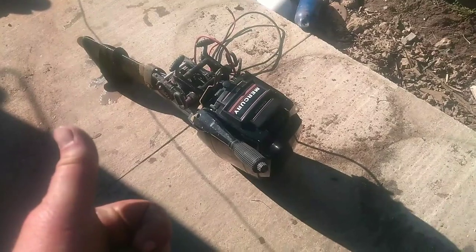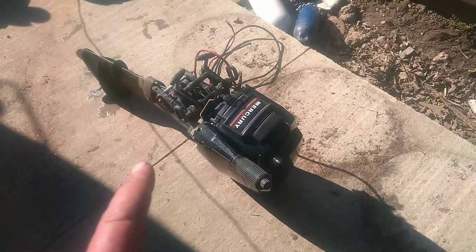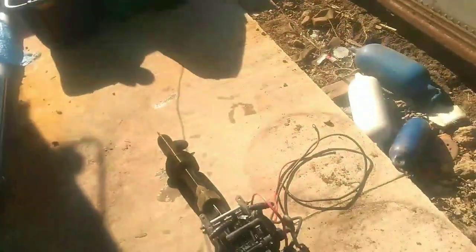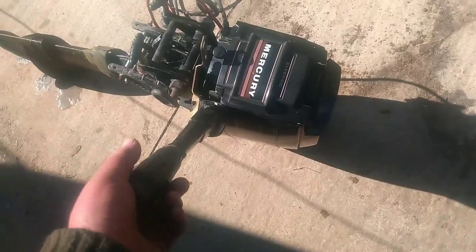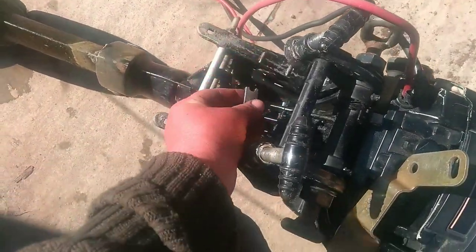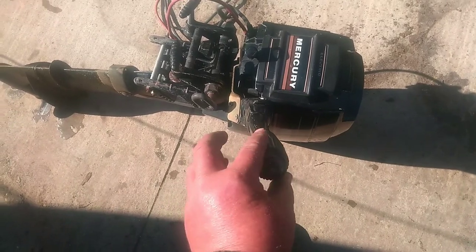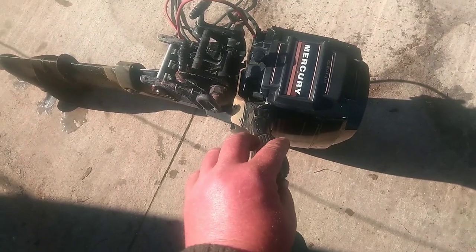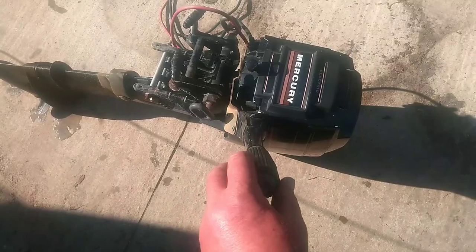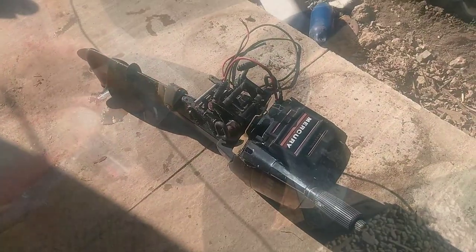This engine was really quite reliable, but there are a few things about it I just don't like. First of all, it costs more money to run than the BMC diesel in this one — and that's a 1500 diesel. The parts are ridiculously expensive: the throttle cable snapped — that's 50 quid. The trolling bracket snapped — that's another 50 quid. Also, the throttle doesn't release, so it's caught me out a couple of times — if you take your hand off, it stays in drive. I'm going to use it for other purposes, maybe as a backup engine, but it's time for it to go.